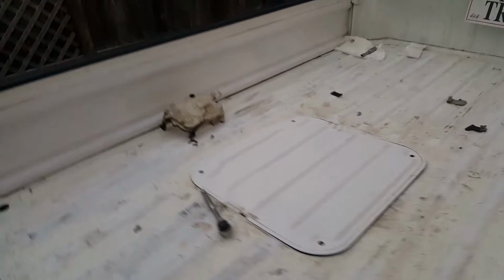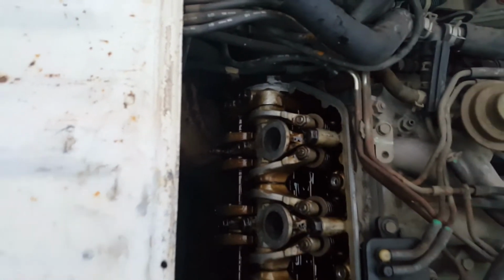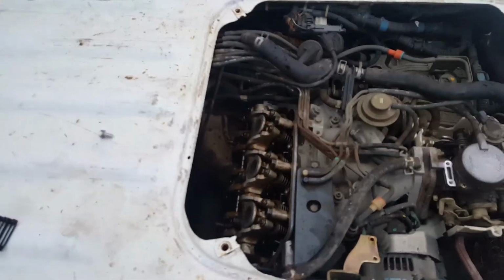Okay. Alright, mini truckers, we're up against the weather here. What we're gonna do is take a little bit of our Permatex Ultra Gray or Ultra Black and apply it here and here, and then on those bottom caps too, just a little dab. I'll put some, and then I'll get a picture and show you. Alright, something like this. Little dab over there, and then put that on the bottom. One of the tricks can be putting that on without disturbing the gasket sealant and try to spread it all over. So we'll see how we can do with that. I've got the head here. I'll go ahead and put that back.